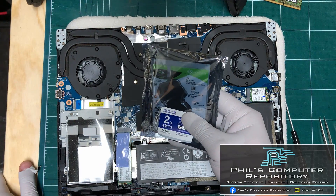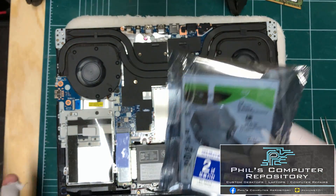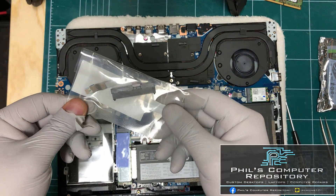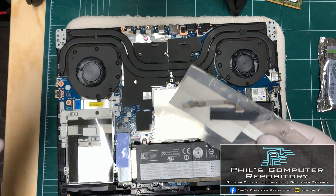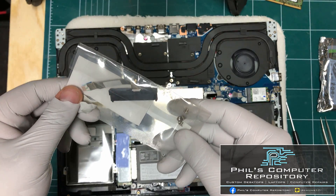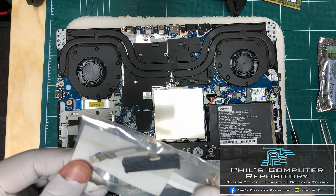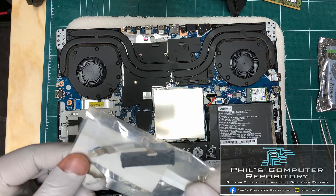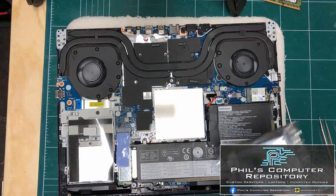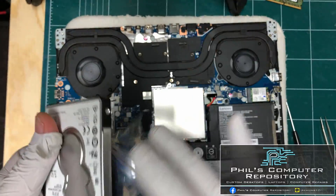For the hard drive, just like in my previous video, I have a brand new sealed 1TB hard drive from Seagate. We'll also need the separate hard drive cable. In South Korea, where this video was recorded, every time you buy this laptop the hard drive cable comes in the box. If you're from a different country and didn't receive this cable, I would suggest contacting your nearest Lenovo service center to see if they can mail one to you.